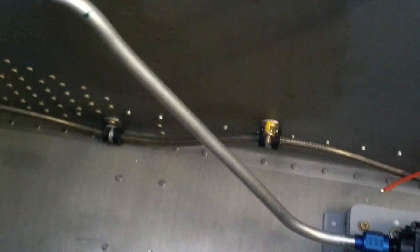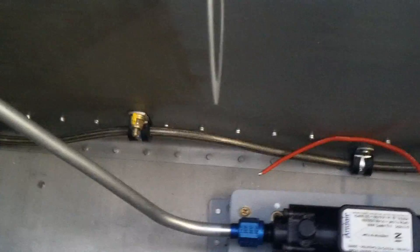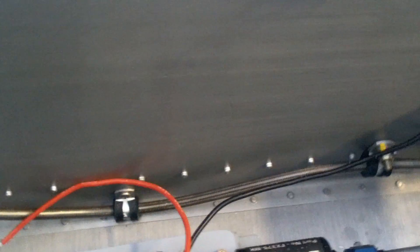Once you get down into the tunnel, you can see where I ran it down here. I did this a little bit different — I picked up the hose between the factory mounts, which are these right here on the bottom. The main reason I did that is to keep the hose from settling down on those rivet tails. It's just really close and I'm not excited about all the vibration being close to those rivet tails, so this picks it up and allows the hose to be raised for the full length.